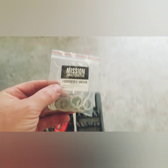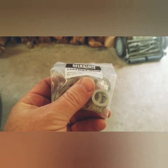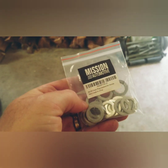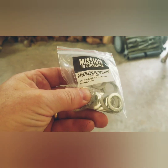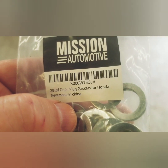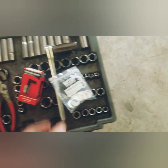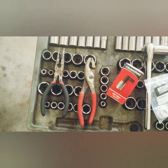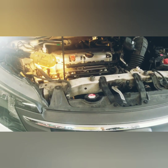You're going to need a 17 millimeter socket and a 3/8 ratchet. These crush washers — they work mostly for the oil drain bolt but they also work pretty good with these. You can get these off Amazon — there's a part number for those, comes in a pack of 20, I think they were like $6. And just a set of needle nose or maybe some regular pliers, and we'll move over to the car and check out where it's located.